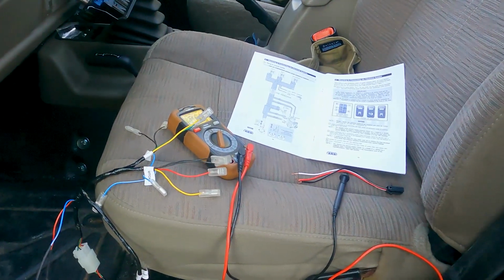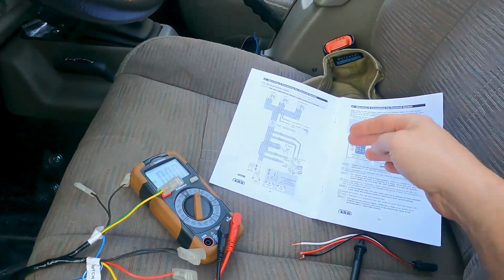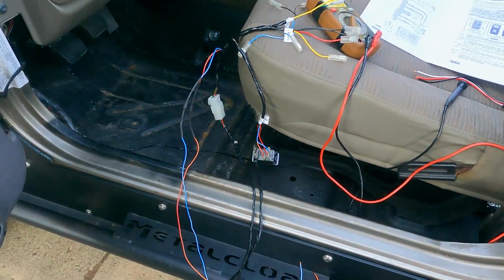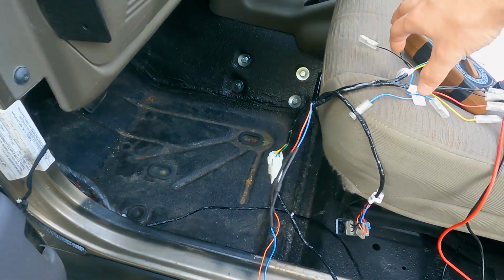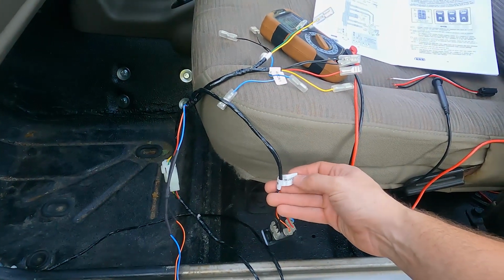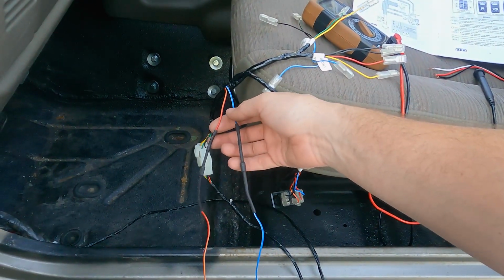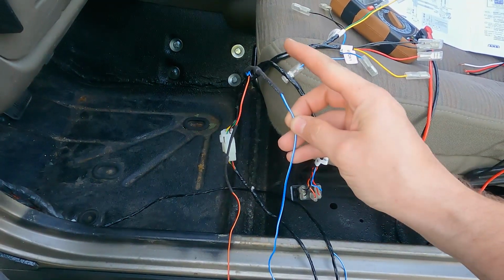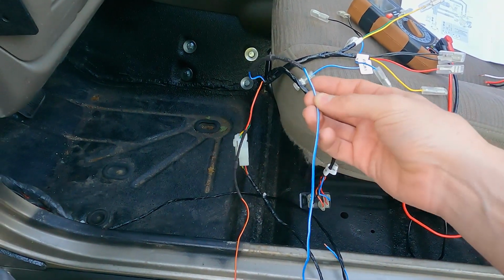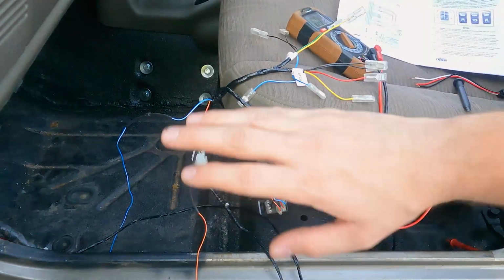So not to talk you to death about wiring, and I'm far from any form of electrician, wiring diagrams are less something I understand and more of a puzzle I can follow and kind of figure out. But from what I understand so far, with not having totally wired everything up yet, once you connect your little switch wiring harness, which is kind of separate from the main harness, you have switch 2, switch 1, and then what they call their isolation switch, which I'm calling the power switch to the compressor. Right before all of these switch wires, you have these two wires that come off the harness. This blue one is to illuminate your dash lights, your dummy lights for your differentials being locked. I don't even know if I can hook that up, and I'm not going to try. So I'm totally ignoring the blue wire, and I'm ignoring the blue wires up here on each switch as well. So those are nothing to me.